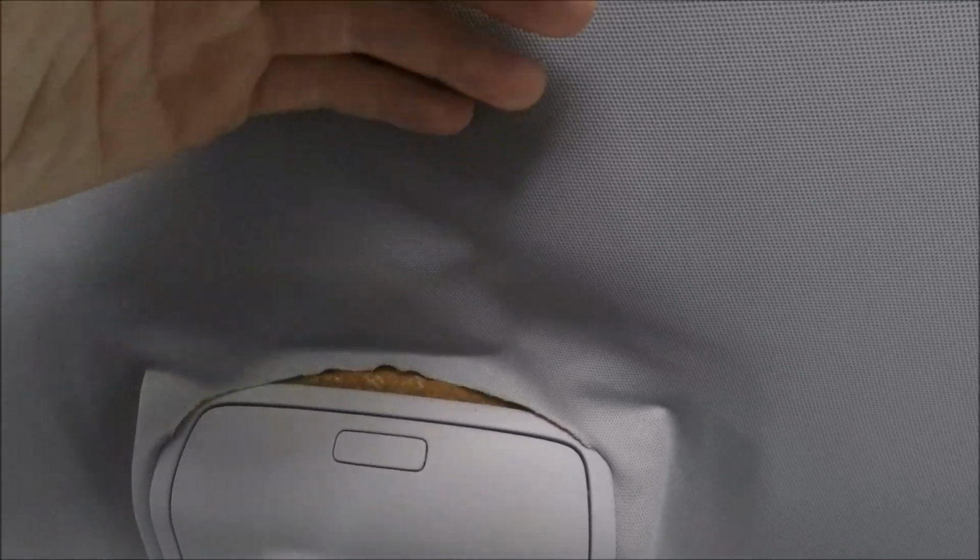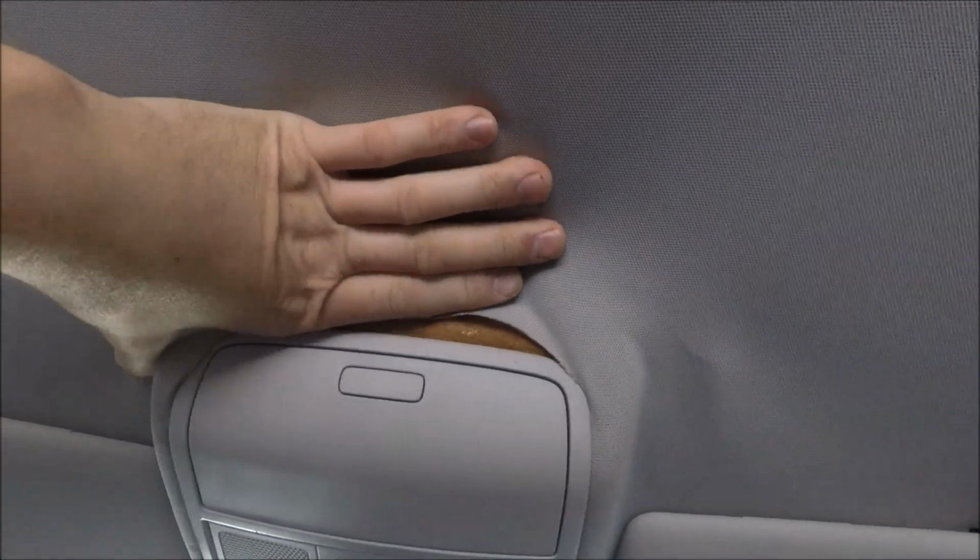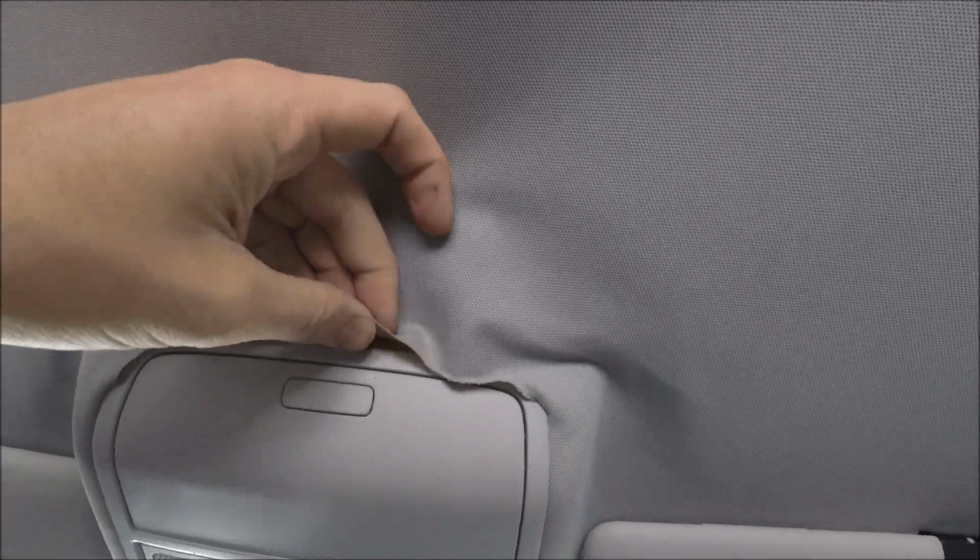But keep in mind, you can do quick repairs, things like drawing pins or a staple gun. I like to use an office stapler because you can get into nice tight areas like up the front here and hit that with a bunch of staples to hold it up. And the staples don't damage the headliner board, none that I've come across anyway. And when the upholsterer wants to work on these cars, they can just pull out the staples.